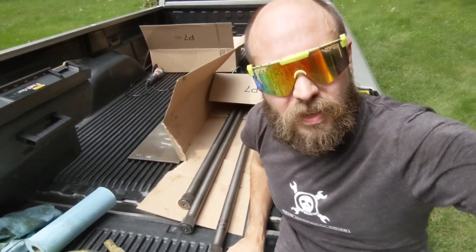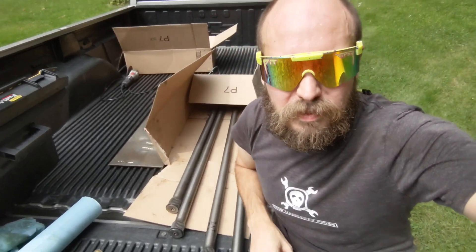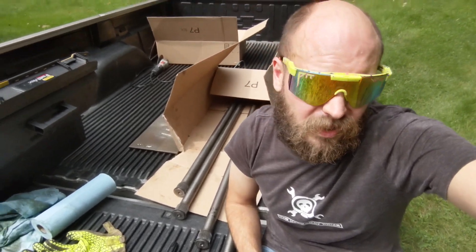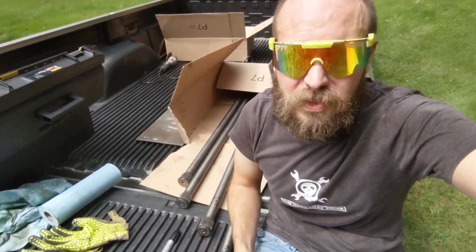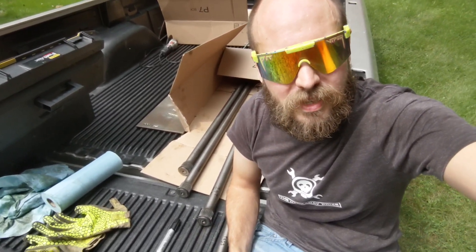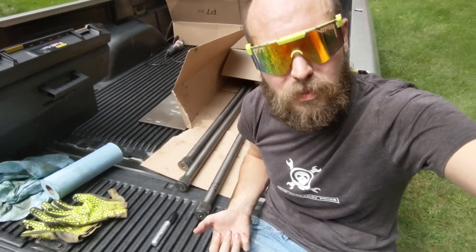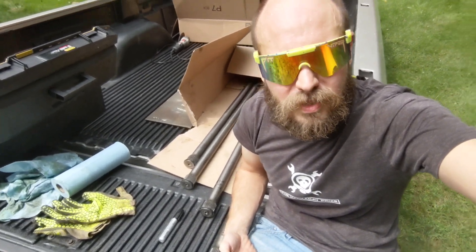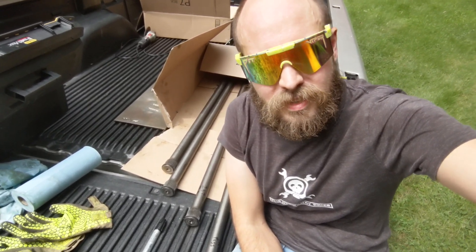Anyway, let's say you're not replacing your ring and pinion set — the differential goo gobber. This is also a really useful thing to know how to do when your truck breaks down, because we both know your truck's going to break down and you're going to need to get it towed somewhere. Because these are six-wheel drive, or four-wheel drive in the case of the little baby boys, you've got to pull the axles or somehow disconnect the wheels from the transmission to get this thing to roll. Pulling these axle shafts is the easiest way to do that. With the four removed, they can either lift the front or flat tow it with the front wheels on the ground — I'm not sure, but I know this is the preferred way to get these things towed. Hope that helps you out. I will see you guys next time.